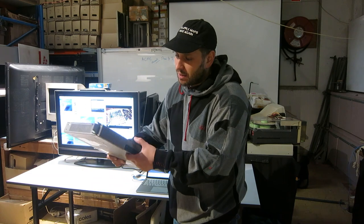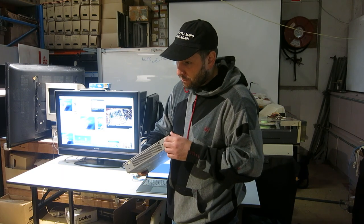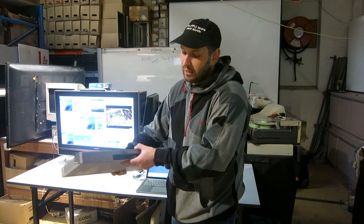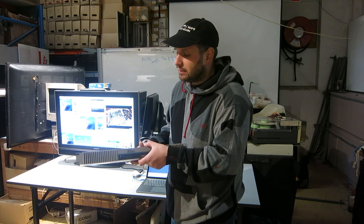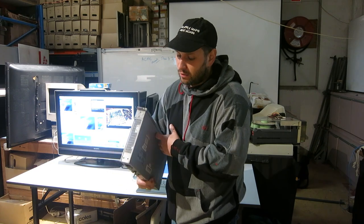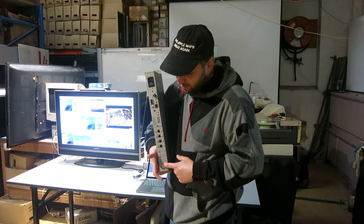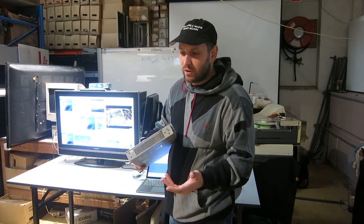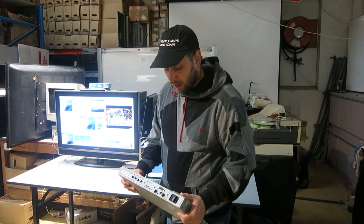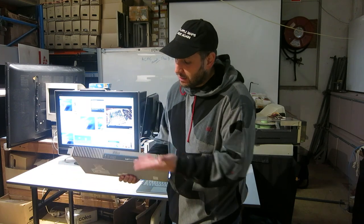The best thing about these was they supported NetBIOS, AppleTalk, and TCP/IP. Particularly for Mac users, which was one of their most popular use cases back then. If you were a road warrior, you could dial into your company's head office. Your phone call would go through the PSTN, dial into one of these modems — up to eight modems in the back of the unit — and it would connect you to the local network in your office, giving you access to your AppleTalk servers and printers.